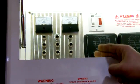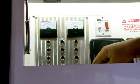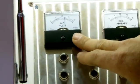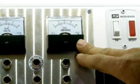Over here we have our 12 volt circuit breaker panel which has all thermal controlled circuit breakers. Up here we have our 12 volt meter which shows exactly how much battery power we've got. Over here we have our DC amp meter which shows how much power we're draining at any time from the batteries.